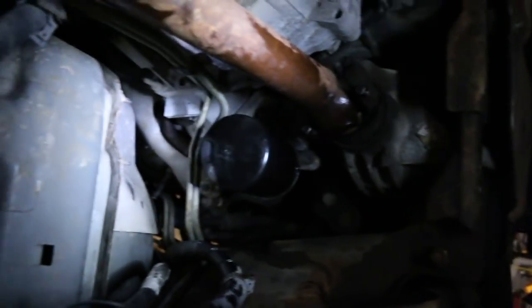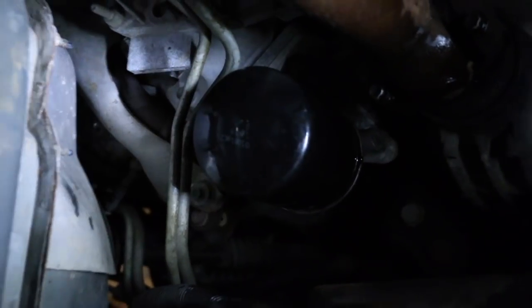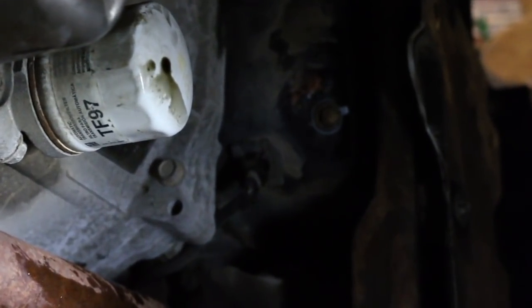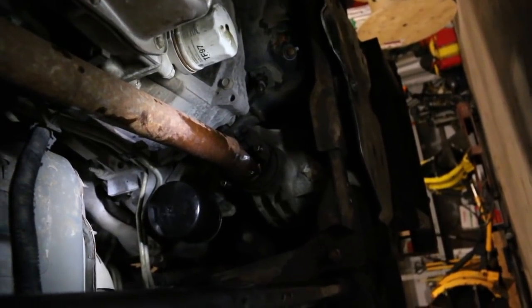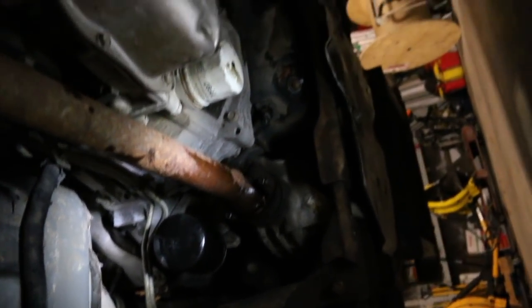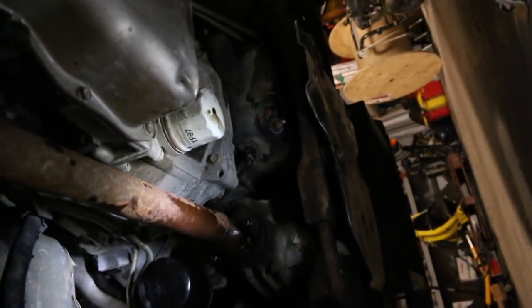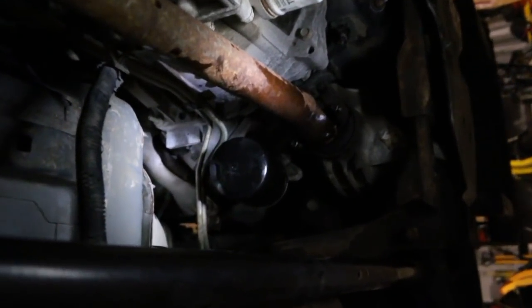You're ready to put these two back on. Real quick, I'll show you exactly where this stuff is located. Crawl under the driver's door and right there you have your filter, and right there you have your plug. That white filter is your transmission filter — don't touch that. You've got your oil filter up to the left, your drain plug kind of right in the middle. The drain plug takes a 16 millimeter.